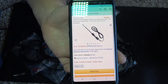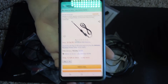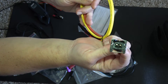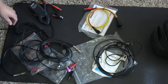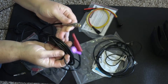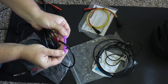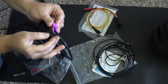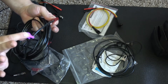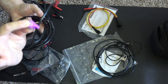Another addition you could pick up for this scope: a coil-on-plug probe accessory, which you can also find on Amazon. The kit should also include a two-pin breakout test lead and four 10-foot test leads. This purple thing is just a magnetic key holder I bought off Amazon — I have them color-coded to each channel on the scope. I use them so that if a lead is in the way of any belts or anything, I can just pop it up onto the hood and get it out of the way.